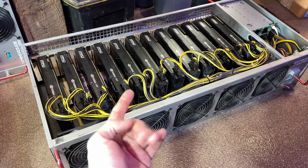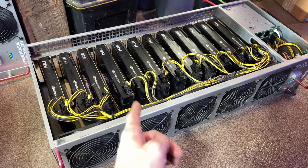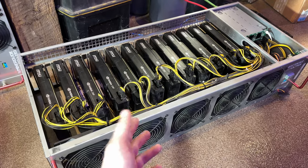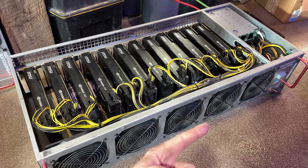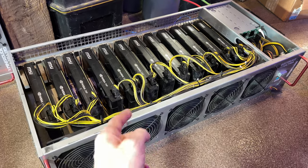What I'm noticing is this has 4 gigabytes of RAM, and it should have 8. So I'm actually going to shut it back down right now and put another 8 gigs of RAM in it for a total of 12, and then I'm going to fire it back up and see if I can get it to misbehave. And I do still think the controller is probably bad on this as well, because when you shut it down, the system does shut down, but the fans go to 100%.